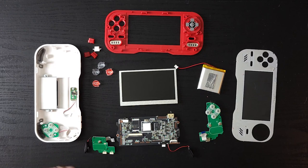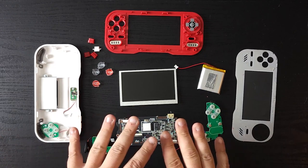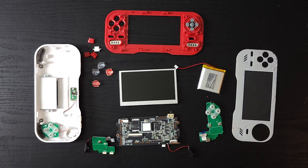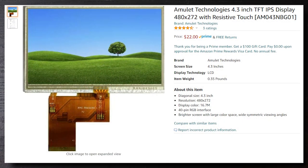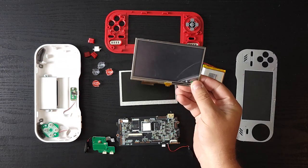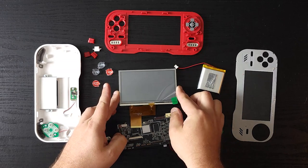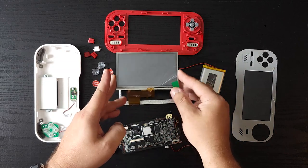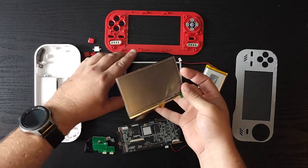I started searching. Granted, I had actually looked up and bought stuff without really confirming if it would work or not before I even disassembled it, just so I'd have everything. But I did find a screen. I'm going to put a link to this in the description below. I bought this on Amazon. This is an IPS screen, and when I compare it up to this, it should fit perfectly. Even the ribbon is 40 pins.